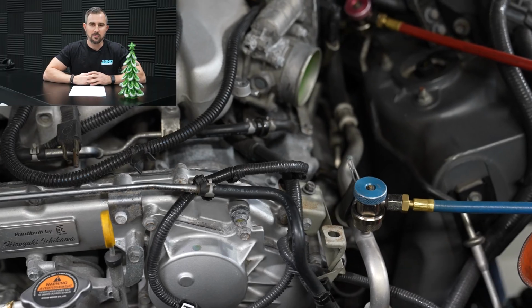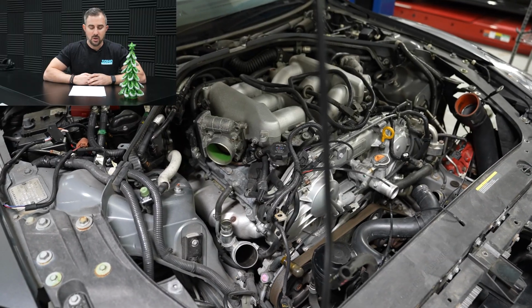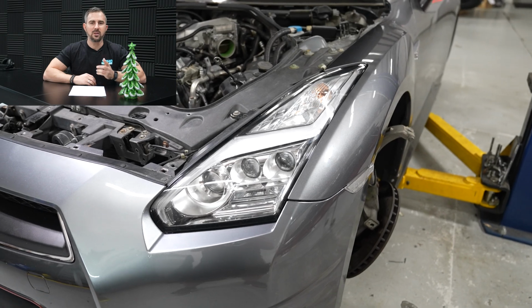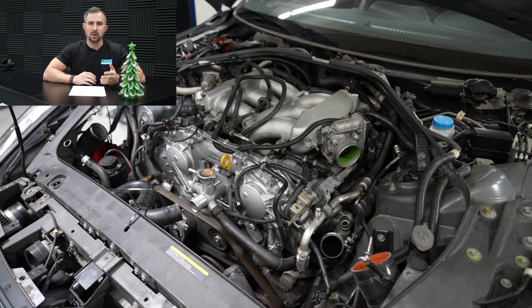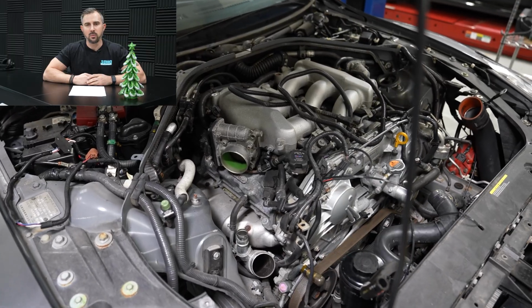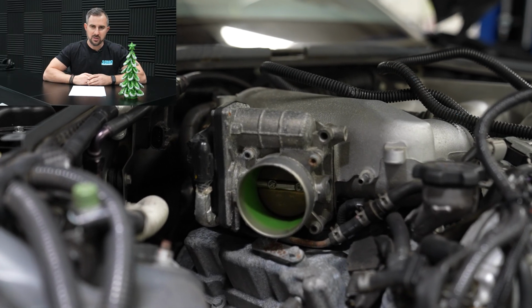Especially when you're running E85, you want to make sure that the pumps themselves do not fail, especially when you're doing high boost pulls. With those options, it had 1050cc injectors. However, it had the old style EV1 injectors. We upgraded those to 1300cc injectors. Those are going to be a great option for when you're going to E85 on the GTR. So that is what we did in regards to the fueling system.